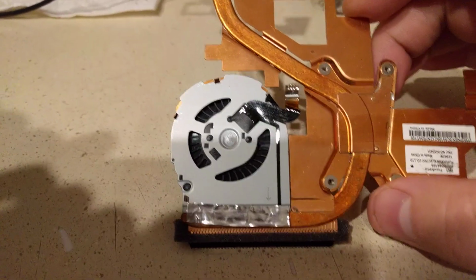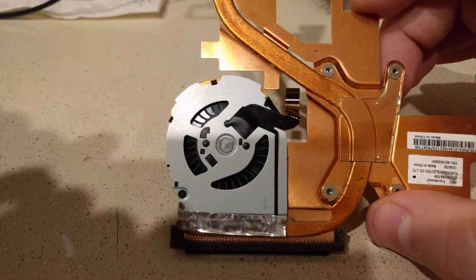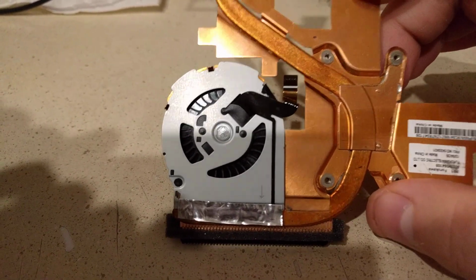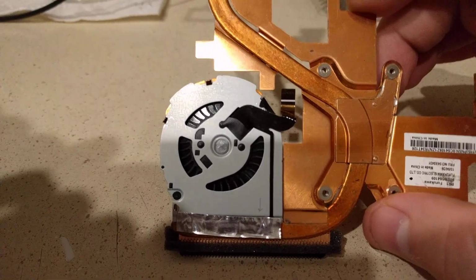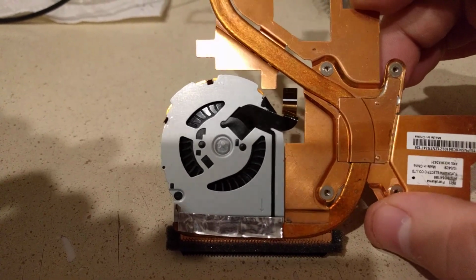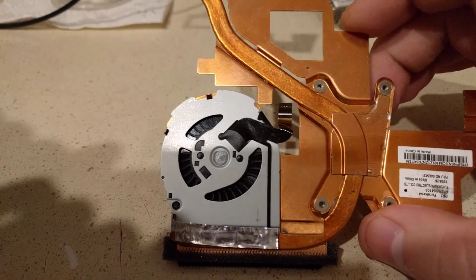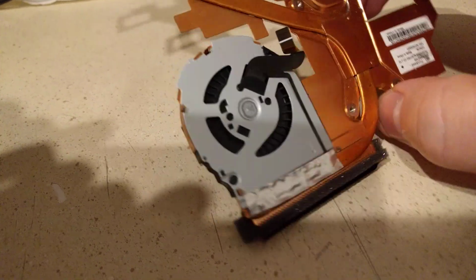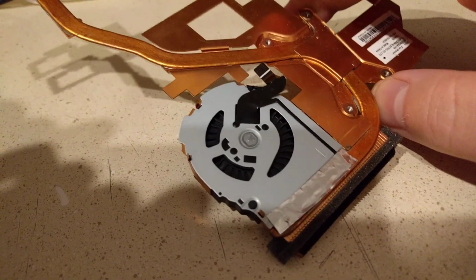In addition to that, any kind of dust or debris that gets in there can cause the fan assembly not to sit completely down into the bearing pocket there, and it causes it to wobble around, and it makes this very characteristic buzzing sound when the fan's trying to run, and eventually gets to the point where the fan slows down and stops cooling the unit effectively.